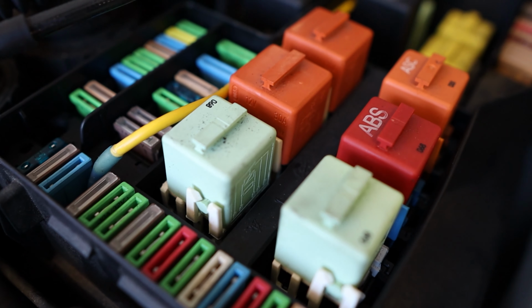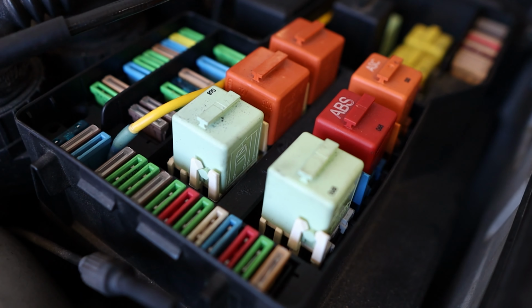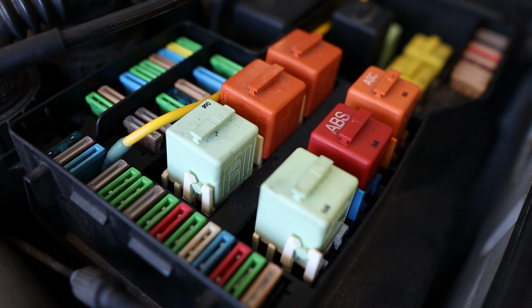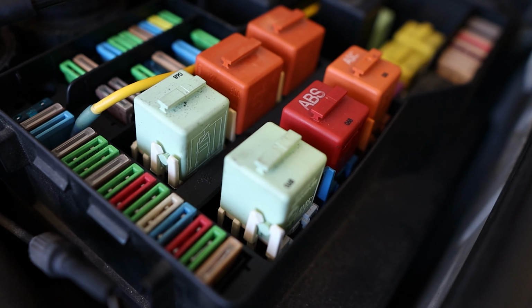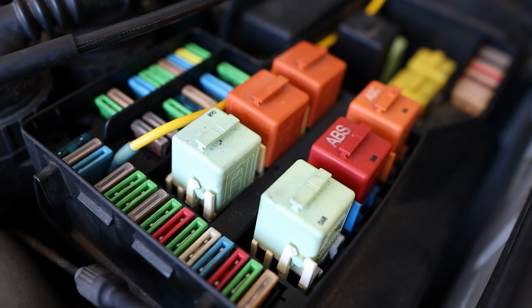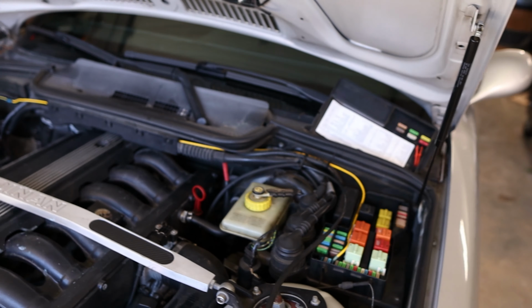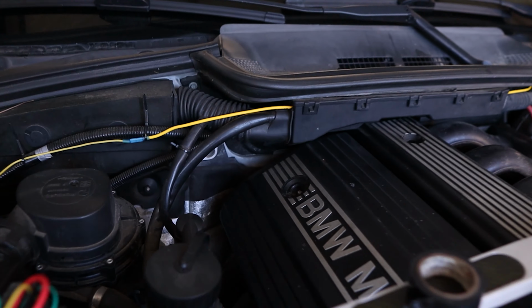All right, you may notice that is not a fuse tap, and that's because it looks like the fuse tap I got from Big Name Auto Parts Store doesn't work. I tested with and without it quite a few times, and I think it's simple enough. I don't know why it wouldn't work, but it doesn't appear to. So I've got new wiring run, heat shrinked, all that stuff.